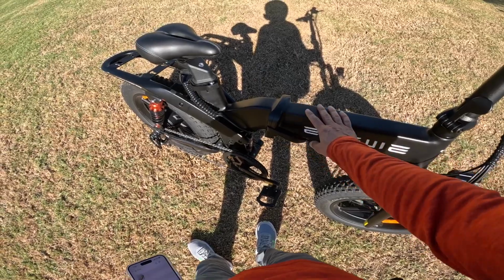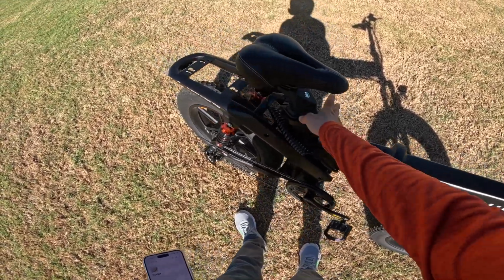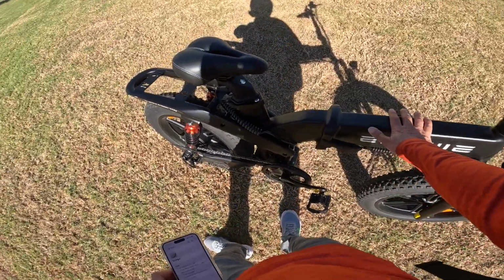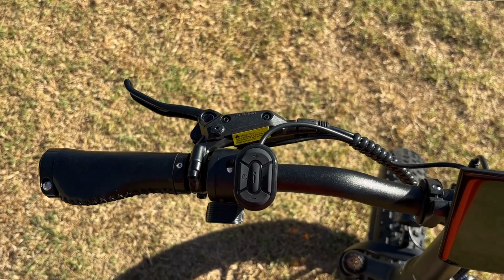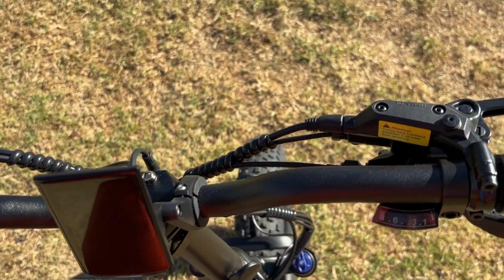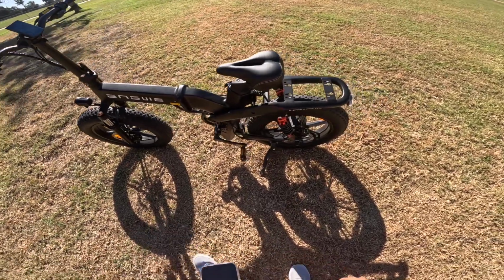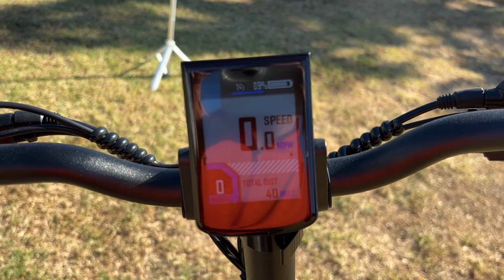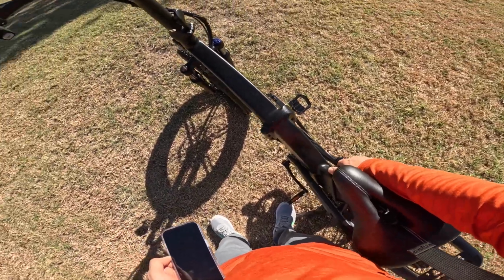But anyway, this folding mechanism houses a 14.4 amp hour battery, and then in the rear this houses a 7.8 amp battery. This battery stays on all the time, and then this one is switched on independently. If you want to charge the batteries, you have to do it one at a time. From 0 to 100%, you're talking 14 hours total. Ouch. And they only give you one charger, which is a 2 amp charger. So 7 hours to fully charge this, and I'm assuming about 7 hours to fully charge this as well.